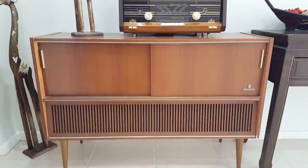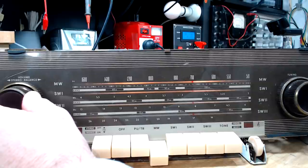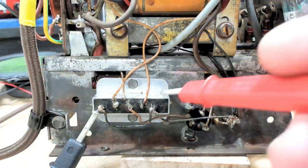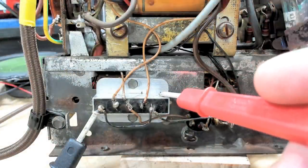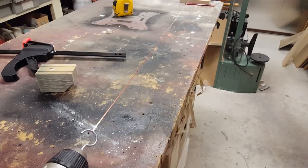Previously on Dave Radio Expenses: a gentleman contacted me and said I could have his turntable as he had bought a new one. I need to do something with the selenium rectifier — I'm going to replace it with silicon diodes. I'm just going to wrap it and we'll see what happens. This looks too thick actually.